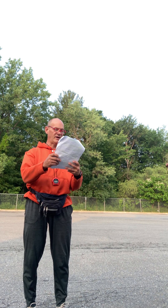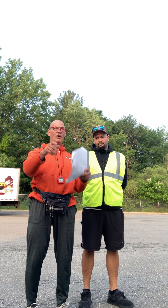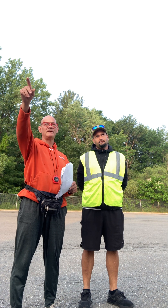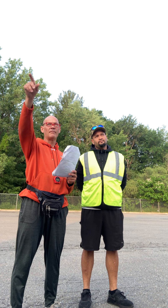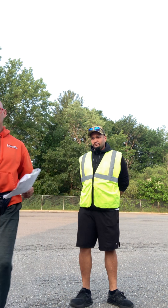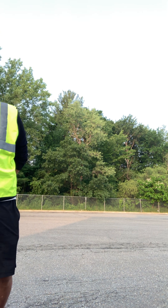We're going to do the front of the truck. The truck is not leaning to the left or right. There are no obstructions around the truck. All my lights are proper color, clean, not cracked or broken. I have two box lights, two cab lights, three ID lights — identifying that the truck is over 80 inches wide. Massachusetts valid inspection sticker. My bumper, hood and plate are all secure. I have no leaks underneath the truck.